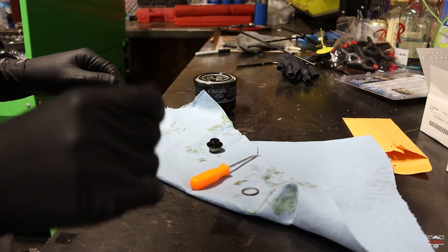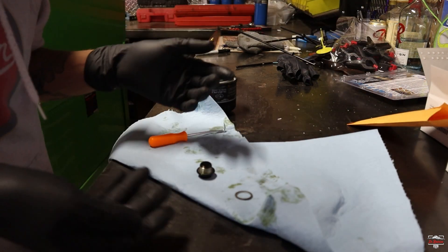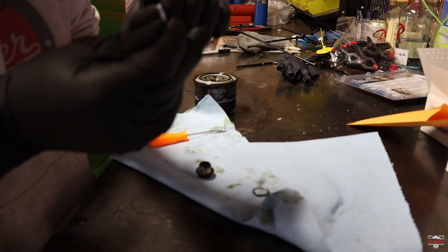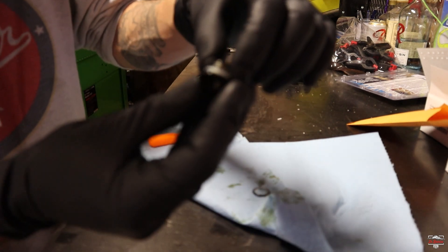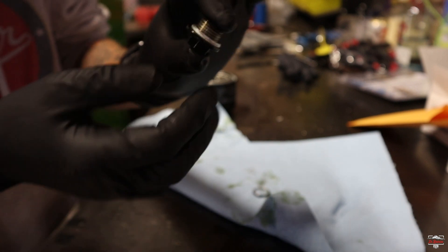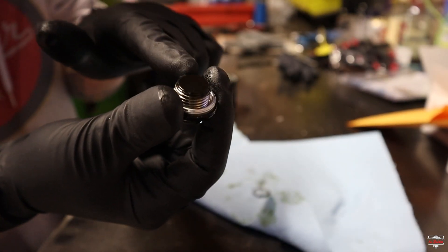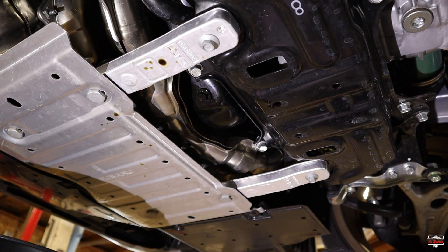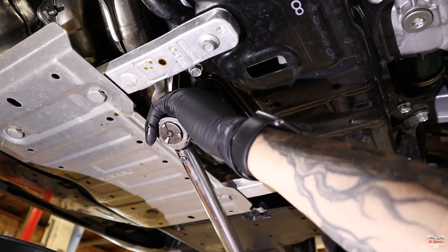Please replace the crush washer — don't not replace it, it's such a cheap part. You have to have the drain plug off to change the oil anyway, so just do it. As for orientation, one side is more flat than the other — I like to put that flat side facing down on the drain plug. The torque spec on the drain plug is 28 foot-pounds. Make sure you torque it to that; don't just hammer it down. There's a crush washer in there, so there's a specific torque spec for a reason.